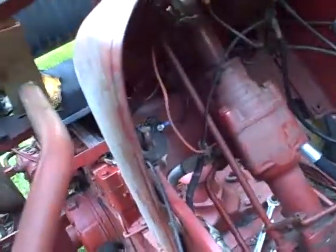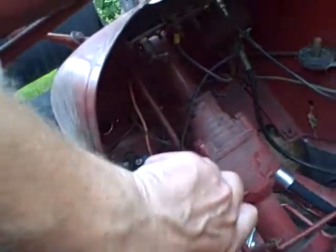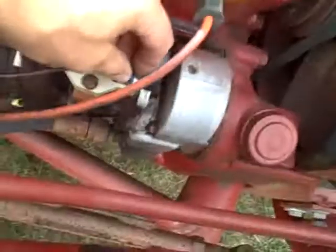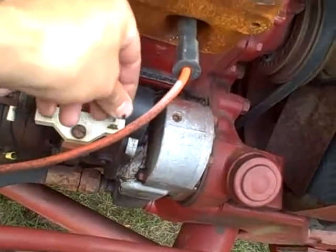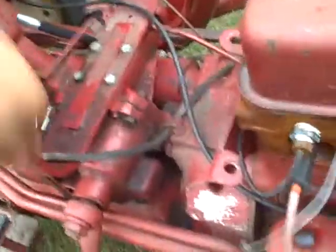I'm going to get that wire from the other side, it's easier to get to from there. Then you've got a 12-volt wire going to the ballast resistor, and that connection was already broken — the wire is just haphazardly stuck in there. I need to fix that later, but for now I'll use that to my advantage to disconnect the wire.